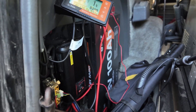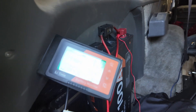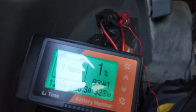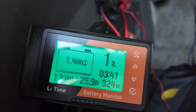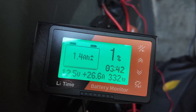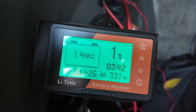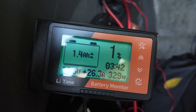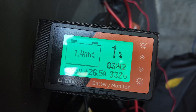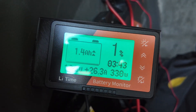I'm going to clean up the wire a little bit, but I actually already had it installed. Part of the installation is setting your max battery voltage and then setting the min. At this point I had already set the min voltage, so I was just letting the battery recharge. If you're installing this, you'll want to do that while the battery is at 100% SOC. And then you can start into the next clip, but I didn't record that.